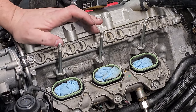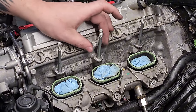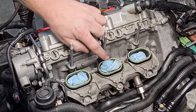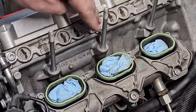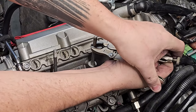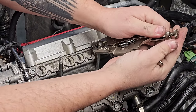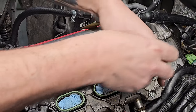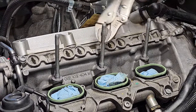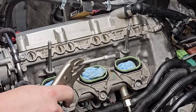The last step in preparation is removing the OEM supercharger studs, since we'll be using bolts to secure the MRA 1900 to the engine. Be aware that as you maneuver the supercharger over the studs, you can get metal shavings off the aluminum — so stuff paper towels into your intake inlets and vacuum everything out before installing. Use a good pair of vice grips, rock them back and forth to loosen, then spin until you can remove them by hand.